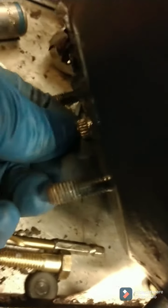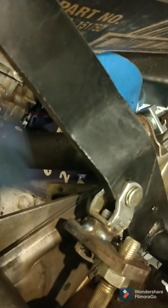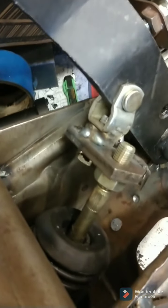The piston is out, so it cocks and it holds it up. See how it goes all the way down? That way, if it's welded, even if the nut came loose, it's not going anywhere. Even if this nut fell out, it's welded and that nut would still be on one or the other. With any kind of modification like this, you check it for a few weeks to see if anything's moved or looks loose. But ultimately, even like this, the play is only in the pin there.